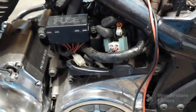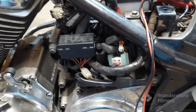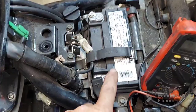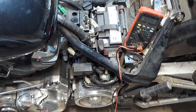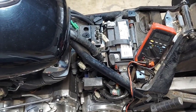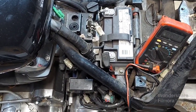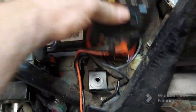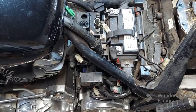So yeah, we went through a bunch of different scenarios here today. When I found the tank empty, like you heard me say in the beginning, I swore that the guy ran out of gas and then cranked it down so bad, killed the battery. I got a borrowed battery in here now. His battery is no good because I guess that maybe even that connection caused it, didn't have a very good connection. So the poor battery was working itself to death and not getting charged up right. Sometimes it was, sometimes it wasn't. And sure enough, that'll kill them. And then it sat here all these months and what have you. It does charge up, but as you saw, it just doesn't have the power to do anything.